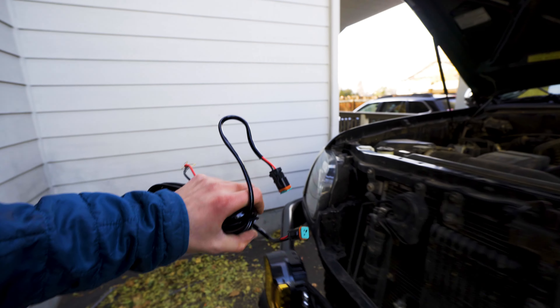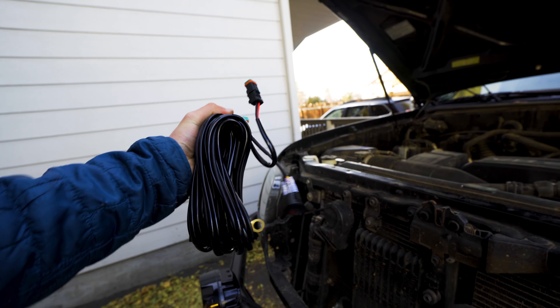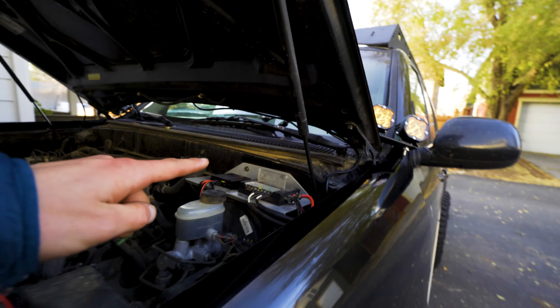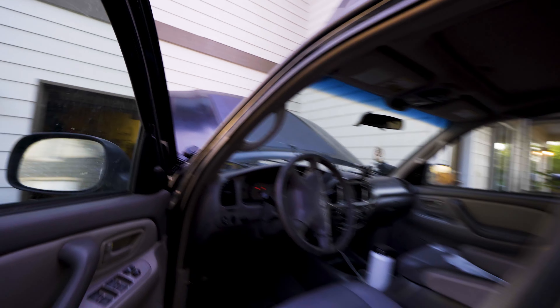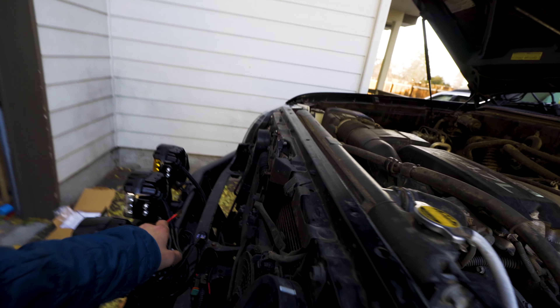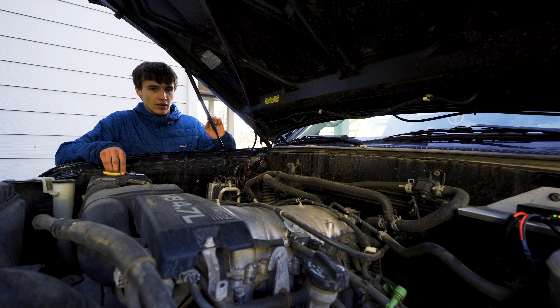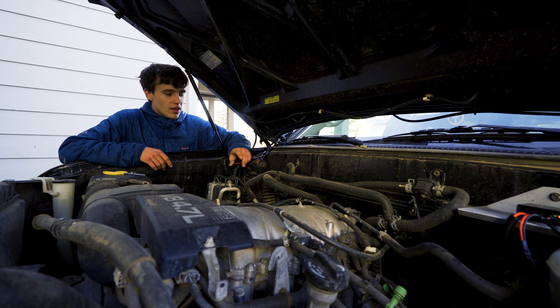There is a provided wiring harness from Auxbeam in this kit, but my plan is to actually customize it to make it my own. The reason for that is I want to use my Auxbeam switch panel mounted right up here — this allows me to control my lights through the Auxbeam panel on the inside of my Sequoia with these buttons. So because I want to wire it up to the switch panel, I'm not going to be using the provided wiring harness. Like I've done with other wiring harnesses, I am going to solder everything together.